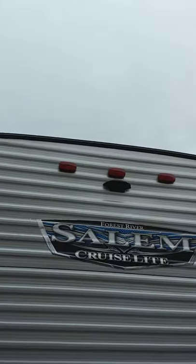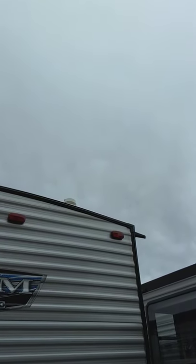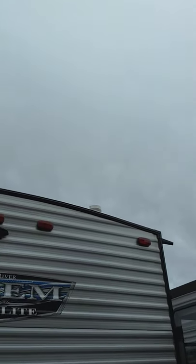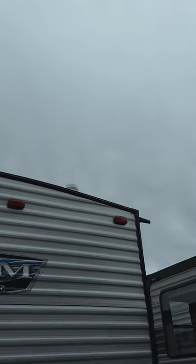You have to inspect your roof — this is very important, not just on this trailer but every trailer ever made. Go up on the roof and check all the seals. It has a lap sealant called Dicor. Make sure the seals are good and tight, nothing cracking or lifting. Inspect in spring when de-winterizing, mid-summer, and in fall when winterizing. Someday you'll need to do some resealing, so always inspect those seals.